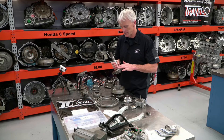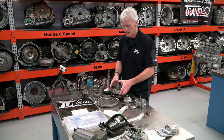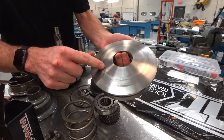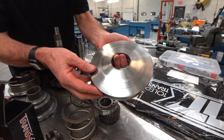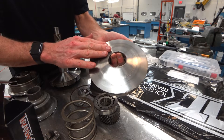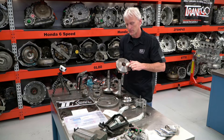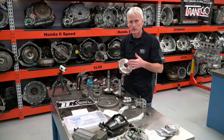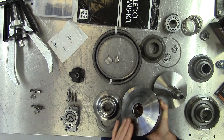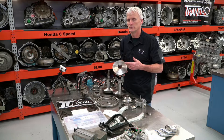Another thing to look at on these is the pulley's surface. Sometimes the pulley will be scuffed — there'll be some radial marking going all the way around it, and you'll assume that the pulley's bad or gouged. Sometimes that is actually buildup on the surface. What a lot of shops will do is chuck this up in a lathe and use sandpaper, working their way up from a coarse grit to a fine grit, maybe ending at 320, and you'll actually be able to get that material off. This happens because the belt scuffed on the surface or trapped contaminants from the torque converter or a failing bearing between the sheave surface and the belt and smeared it on there. Because these surfaces are extremely hard, there's less chance the pulley is gouged and more chance it's actually torn up the belt.